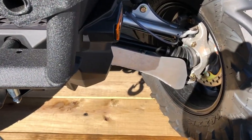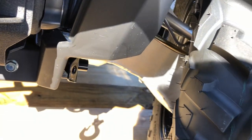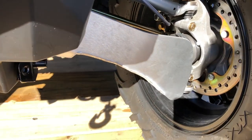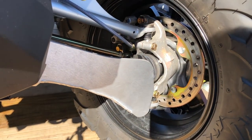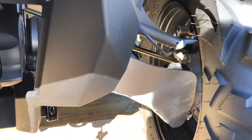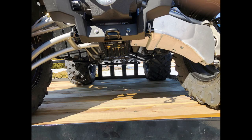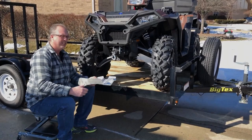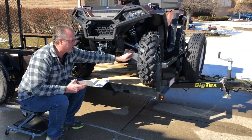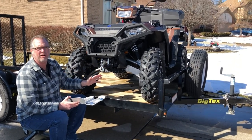Now we're just turning the wheels back and forth, getting a feel for whether it will grind or anything like that — and it won't. We haven't pushed it in more towards the center yet. Seems to be working pretty good on this one. We might adjust them out just a little bit for more protection. We got one CV boot guard on now, snugged but not super tight. Pushing it towards the center definitely helped with the fit.